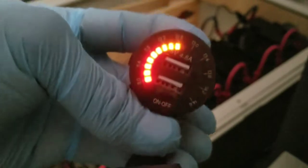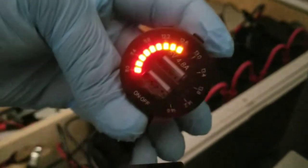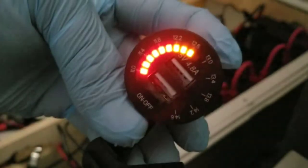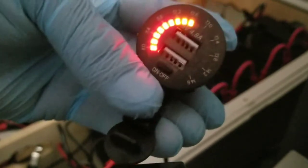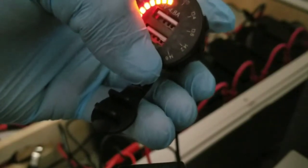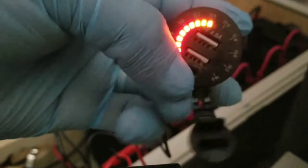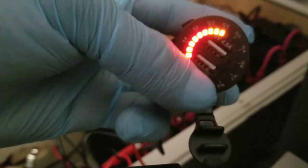Part of the machine does a diagnostic and it sits right away to 12.6 — so that's the state of charge. If it's an alternator in the car you might be running all the way to 14 volts when charging the batteries. This is the state of charge.